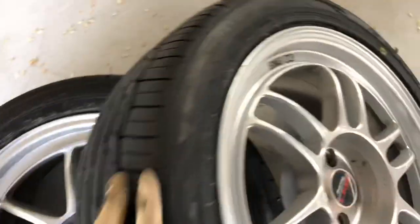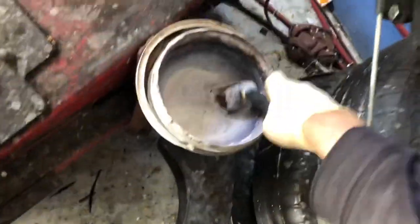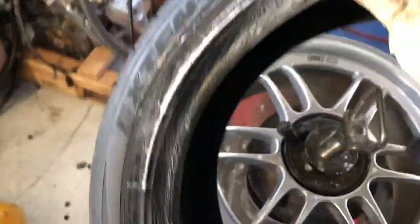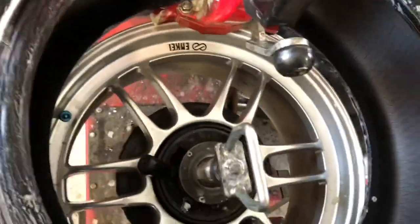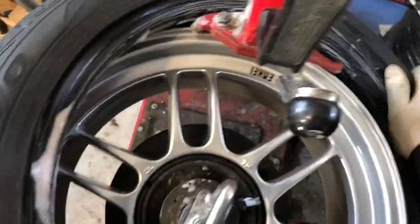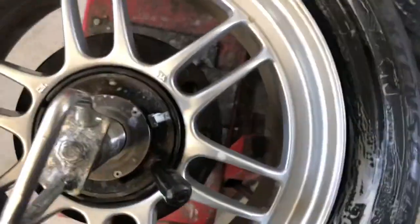These tires are directional. I've got my two rights already and I'm going to get my two lefts. We're going to look at the sidewall and see where it says 'left.' Now we've got our lube — let's get the rim of the tire. Make sure you do it on both sides. It doesn't have to be perfect, we can clean the tires up later. Then set this down, bring this up, and just hold it — that's going to help us.